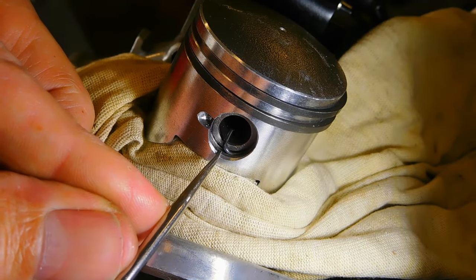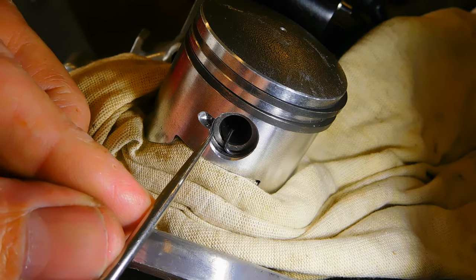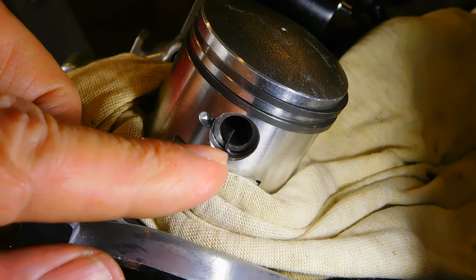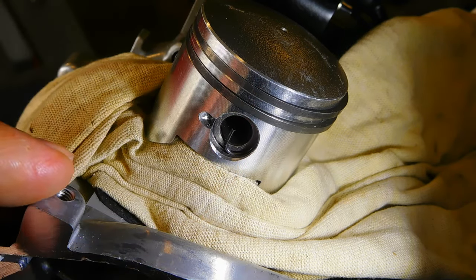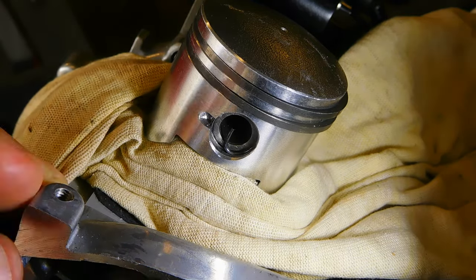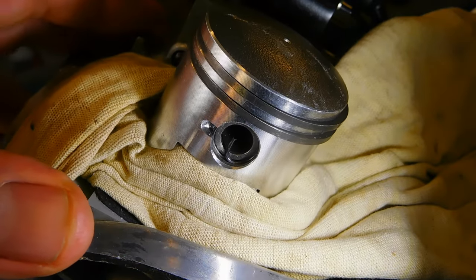A second note: because the slot has a radius and the circlip is round wire, if you use a square-shaped snap ring instead — maybe because you've lost the correct one — that's going to come out too. It'll go into your transfers and chomp-a-rooney.